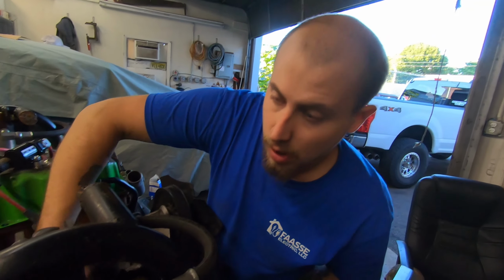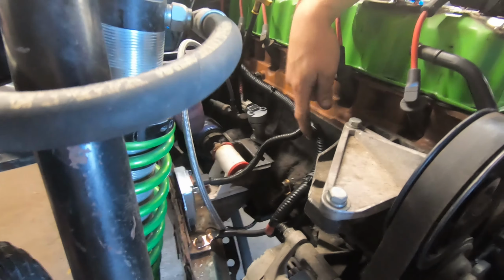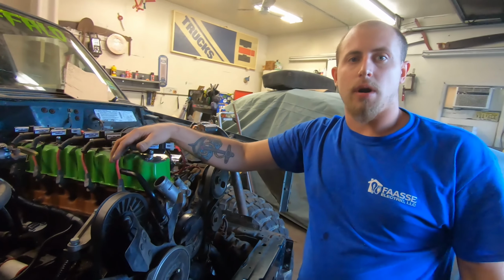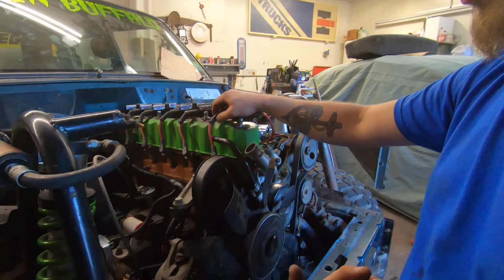Last time we left off, the only thing I really had on this side was the ground wire. So I ran the alternator feed wire, and I plugged it into the two source wires that come off of an alternator, or at least a Chrysler alternator. Megasquirt has a way to wire it through the computer, because on regular Jeeps and stuff, it's regulated through the computer. Someone gave me a little secret, Anthony again, that you don't need to use the computer to regulate it. We're actually using an external regulator off of probably a Cummins, a bunch of other older Dodge stuff. I'll put the link in the description for that.